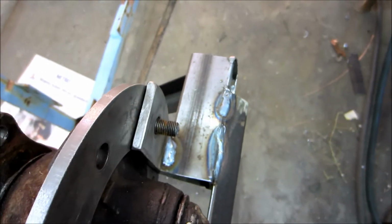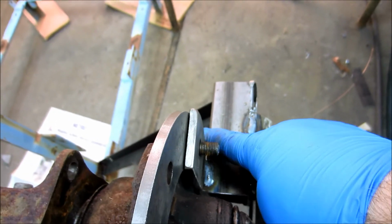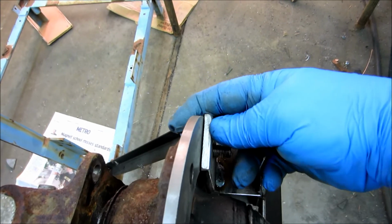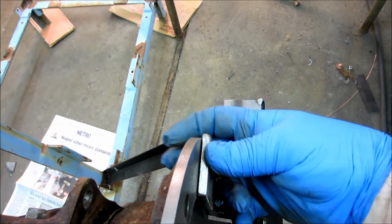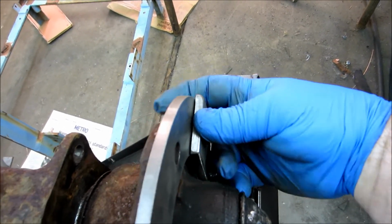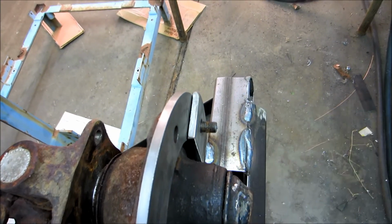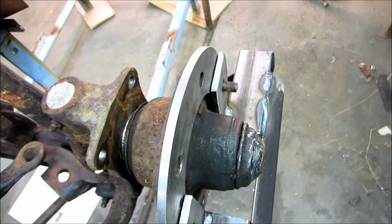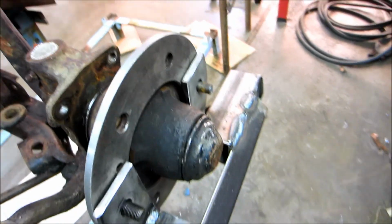and that's just the jig sagging a little bit. When I welded it down here, you know, it pulled and leaned out just a little bit. When I tightened the bolts down, you know, all that squeezes back together. This flexes a little bit. All within 1/8 of an inch or less. I'm really not too worried about it.